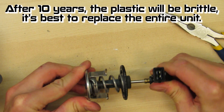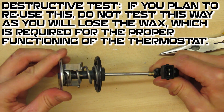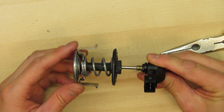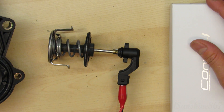If you want to test it out, just slide it in and make sure it slides back and forth freely. There's some waxy element in there that helps it slide around and expand. If you plug in 12 volts and heat it up, it should pop right off. Be careful when doing this because it could bind — put something in front of it and behind it so it pops out and doesn't go flying everywhere.